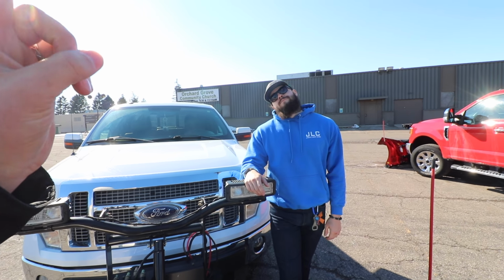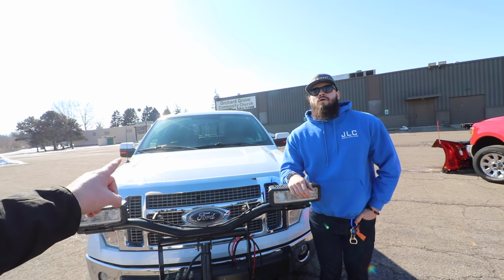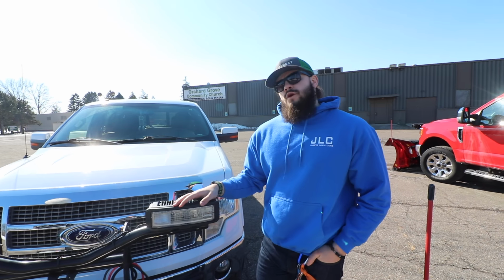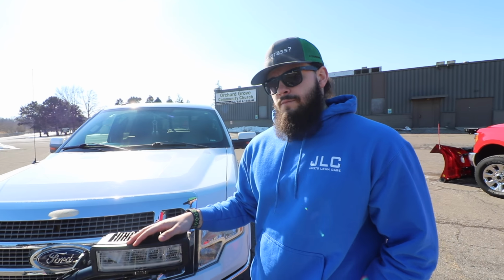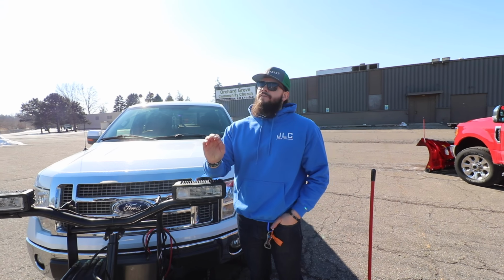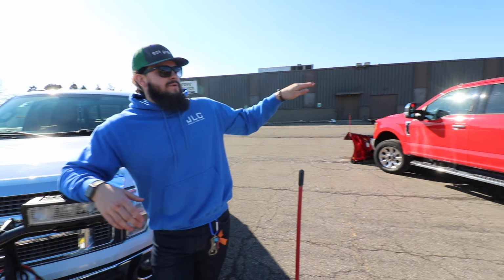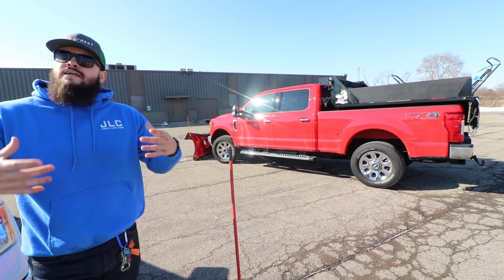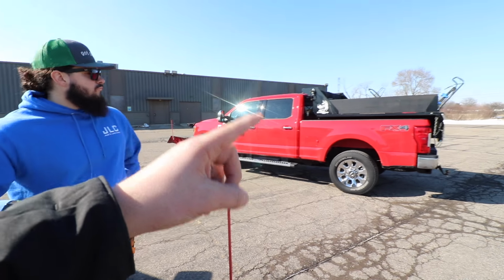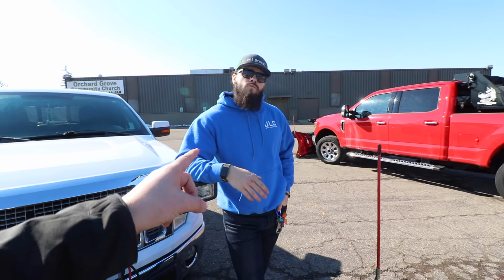Let me ask you this: did the back end kick out of the truck? Never. I got 420 pounds of sand just in the back. But I don't have the luxury, with your dump insert, of adding a lot of weight, because you can probably plow sometimes in 2-wheel. I can. This thing weighs like 800 pounds, and many times I was trying to plow in 2x4.